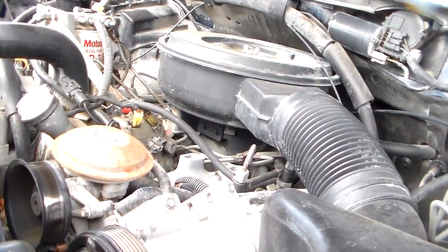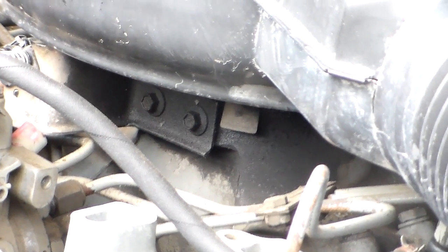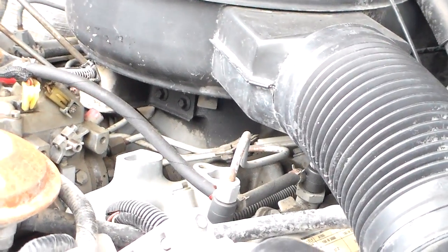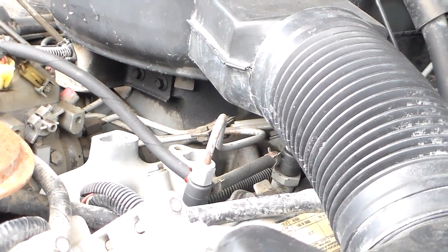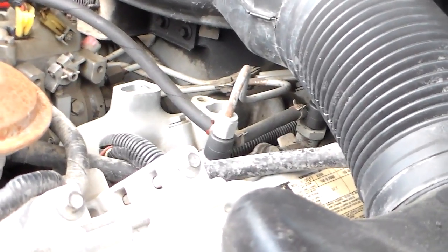Well, I'll just tell you, it's a diesel like this, one of these older ones. The air that goes into the engine is not regulated. There's no throttle blades or anything like that right there at the air intake, on the intake manifold, or plenum, or whatever you want to call it. There's no throttle valve there, so, according to the Venturi principle, that's what creates a vacuum underneath it. Without throttle blades, there's no vacuum. A diesel like this is just open to the atmosphere.